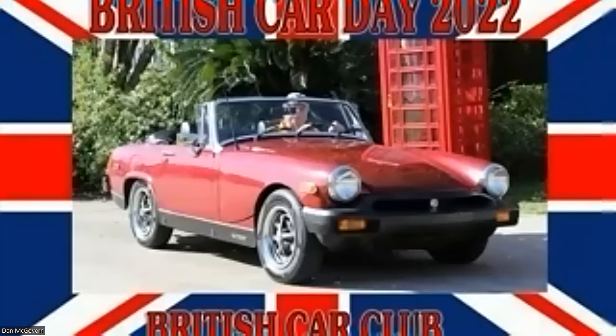Okay, all right, okay. And I have halogen H4 headlights that I just bought, cheap LED headlights. So with the lights on, I draw 5 amps total with everything on. Oh my gosh, 5 amps with everything on. That's like nothing. That's two more amps than the coil takes.